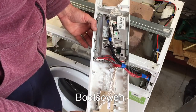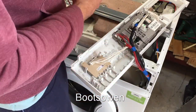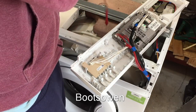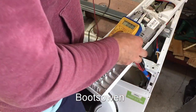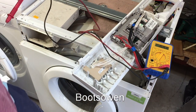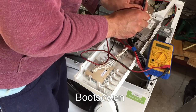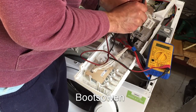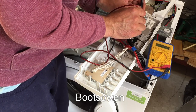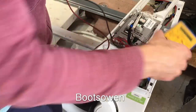How far do I want to go without unplugging it? Can I get the multimeter in there? Let's give it the voltage again — the machine's still live at this point. It's getting 234, 233 volts here. So I'm guessing there's a problem with the board.